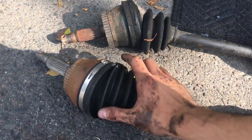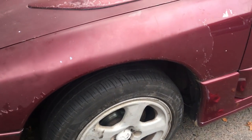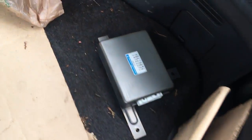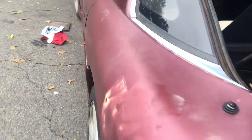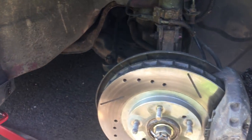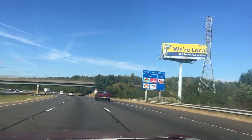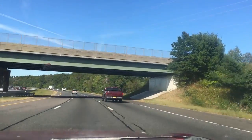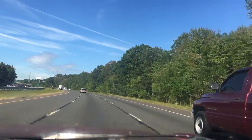The old one's out, the new one is good. After you put everything back together, put the wheel down and torque the axle nut to factory specs — and now we're done with this side. We're gonna do the other side and then quickly connect the used but working ECS computer to the plug to see if our suspension works properly. It's the same procedure on the passenger side. Here's a clip of me driving after replacing the struts — this car drives super nice. All that clunking and banging around that sounded like the car was falling apart was all due to the front struts being bad.